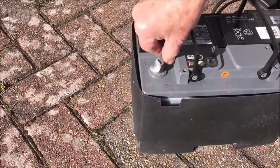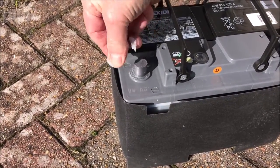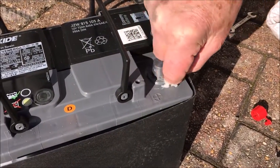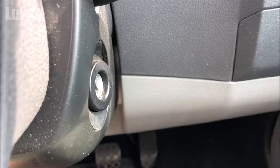For the top tip with petroleum jelly: you can buy special battery paste, or just take some petroleum jelly and smear it on the terminals. This stops them corroding over time and keeps them in good condition. If you're going to be leaving your battery disconnected for quite a while, it's a good idea to put some rags over the battery terminals or some caps.